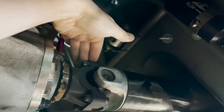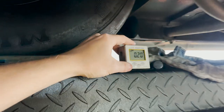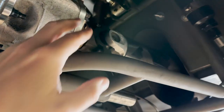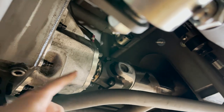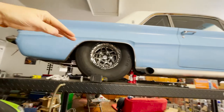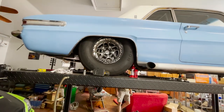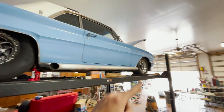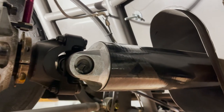What you do is measure the top of the pinion, add them together - it says so in their instructions. He's going to use the top bar up there to adjust it. He's got this handy-dandy little angle finder. Right now we're about 1.5 degrees - that's kind of where we're sitting. We need to get to about 3 to 4 degrees on the pinion angle. That will help with the separation in the body - as the car runs and the rear end starts to lift, it'll bring the pinion angle up to about zero. You don't want it to go positive. We need to lower the front down a little bit. There we go - that's about 3.5 degrees of negative pinion angle.